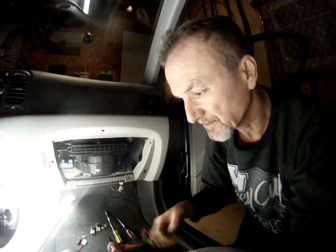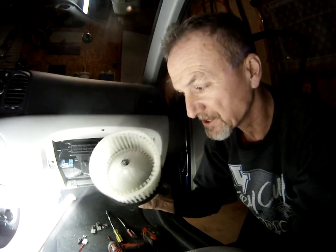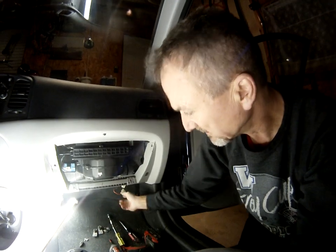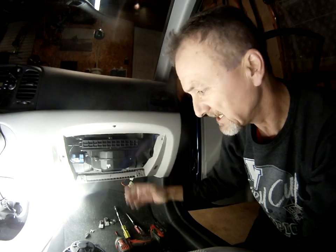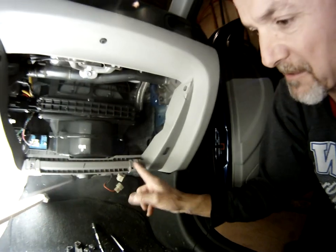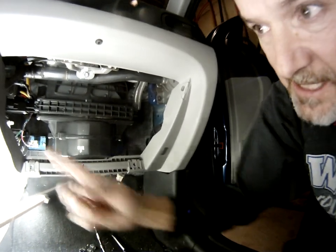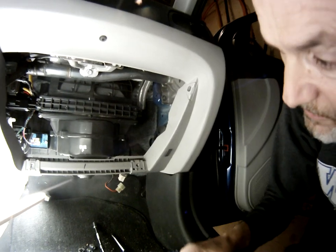She called me up and said hey, this is what's going on. I said I'll pick one up for you. This one comes with a squirrel cage, which is great — you don't have to change it out. There's your wire adapter. To get access to this one is really easy. Like I said, you don't even have to remove the glove box. There are two 10mm bolts here and here for the glove box, and two little clips on the sides.